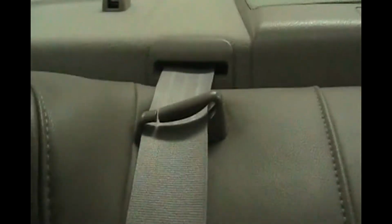So just throw the seat in and then get the seat belts on the outside. There's 3 seat belts, so don't forget the middle one. You got to get all 3 seat belts on the outside of this upright portion of the seat before you try and hook it. Okay, so lift it up. It's a tight fit. You've got to get up to here with the seat on both sides. Lift it up and then get it against here and drop it down so those 3 hooks at the top go in the slots. And then thread your seatbelt through here. There's a little opening for you to put the seatbelt through.